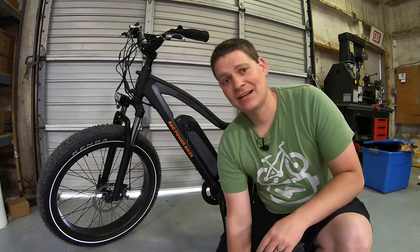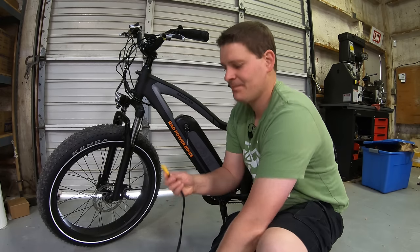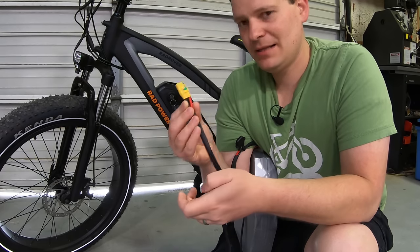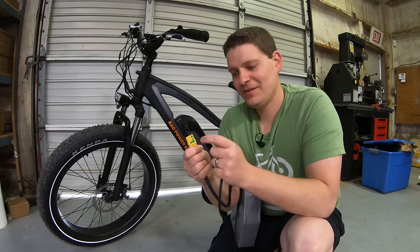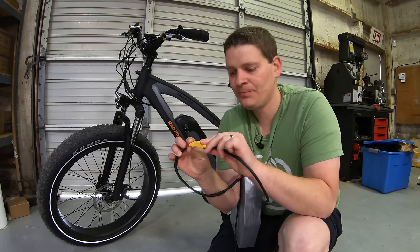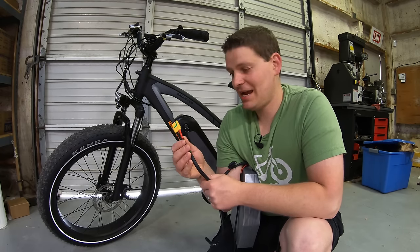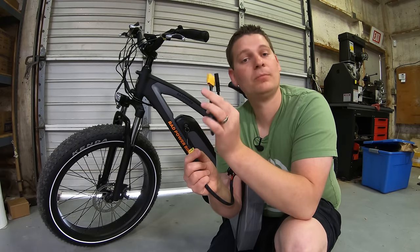The battery is proprietary and that causes one other problem, which is that the connector they use isn't a standard connector. This is an XT90 anti-spark connector on our triangle battery. The little green part on here indicates the anti-spark function. Basically what this does is when you plug in a battery, sometimes you get a really big spark right there. But because of the special design, it slows that process down a little bit so you get a little spark. On 48-volt batteries or larger, that spark will eventually wear the connectors down — they'll start to turn black and don't connect as well — so this is an ideal connector. The controller and the battery that are on the bike don't use this; they use something different. So we have a handy little adapter to make this entire thing plug and play.